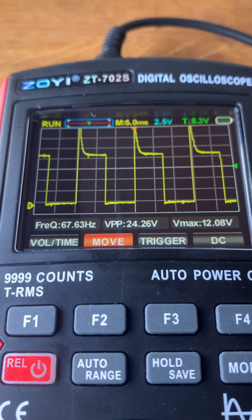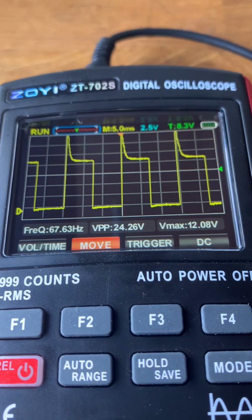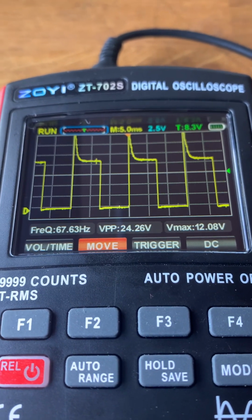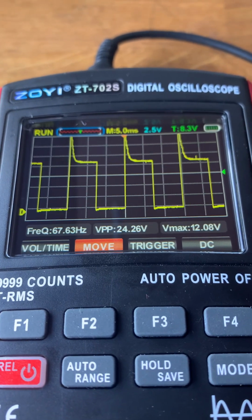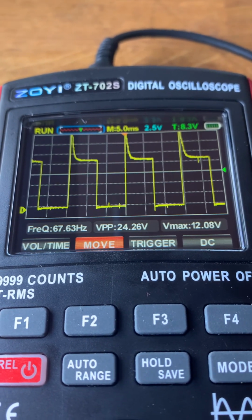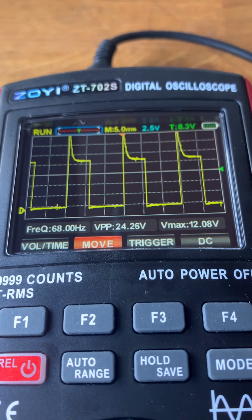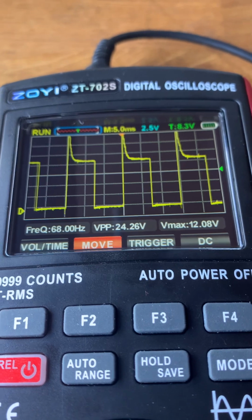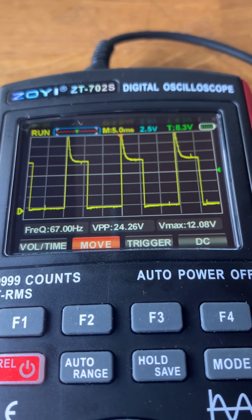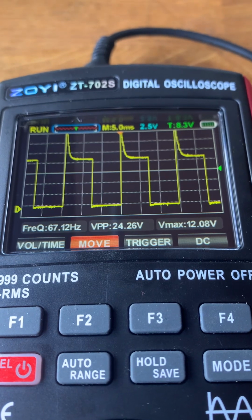The full throttle switch is designed to richen the mixture up. So you'll see that it will increase the duty cycle, which effectively richens the mixture up. So you'll see it change. So that's the full throttle switch hit. Off, on. Oh, so it's run to about 60% duty cycle, I'd say, and that's about a 50% duty cycle.